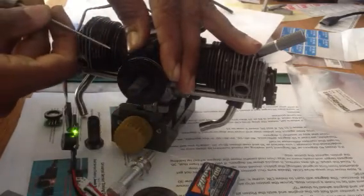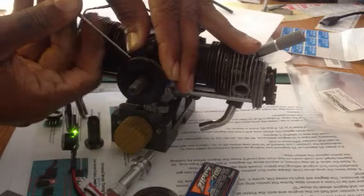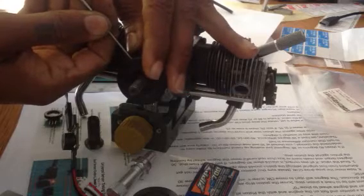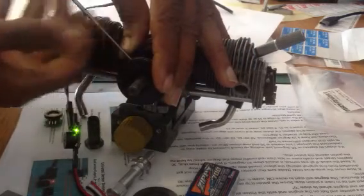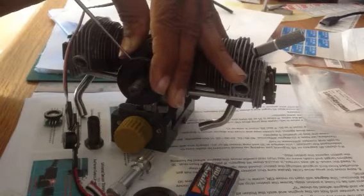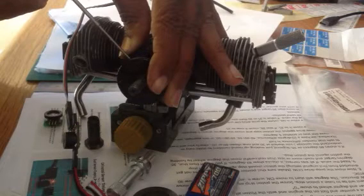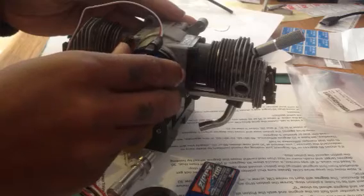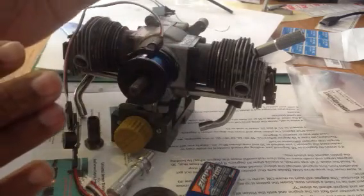Get a wrench just to tighten up. Move it a little bit more — this is where the really tricky bit comes in. You have to have a really steady hand. You want to tighten up just when the light goes out. That's your timing set.